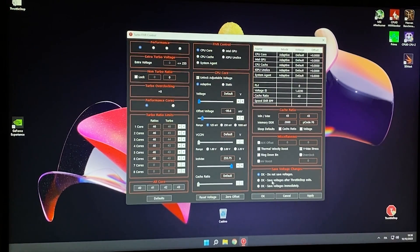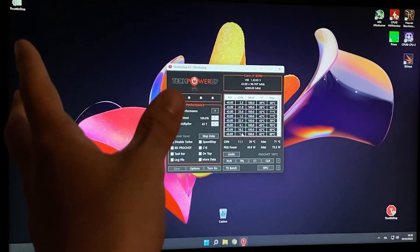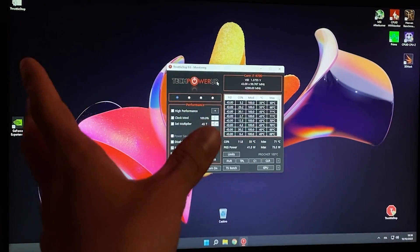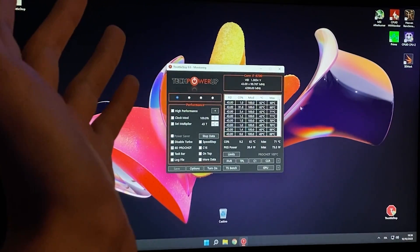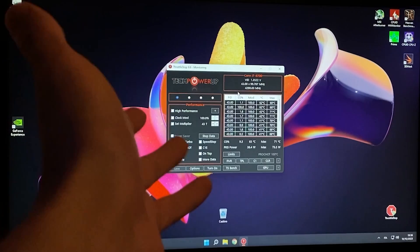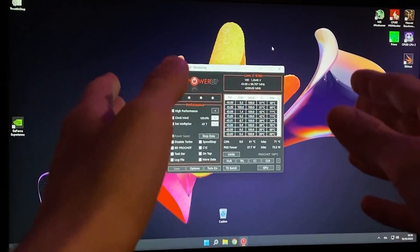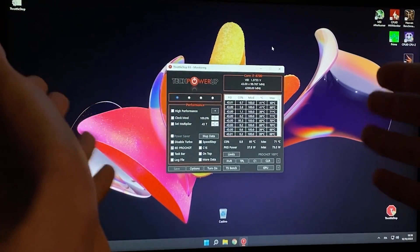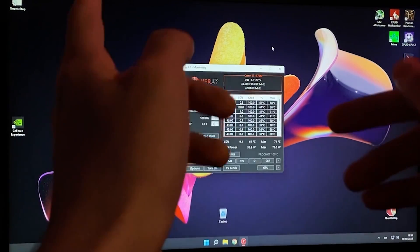At this point, click on OK, save voltages immediately, hit apply, hit OK, and boom — you are now effectively undervolted and your core ratio is actually boosting a bit higher. So we won on all sides. If you go ahead and test out just how nicely the CPU runs, you will find you probably have 20 degrees less heat in your system. If this was helpful, please subscribe to the channel as I have many more tutorials, even for different CPUs and GPUs, as well as very good budget builds like the one we are undervolting here today.